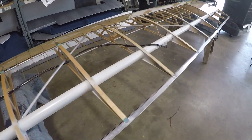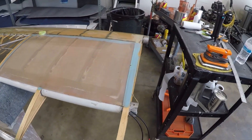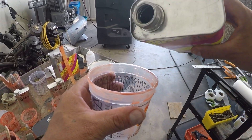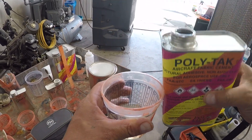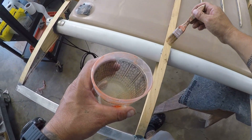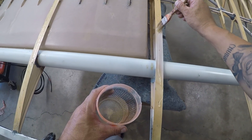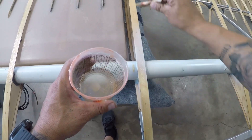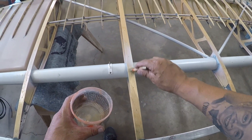Now on a Kit Fox wing, the bottom of the wing is actually under-cambered. So before we start covering, we want to take some poly tack straight out of the can and pre-coat the bottom of the ribs. The reason for that is because of the under-camber — you basically want to glue the fabric onto those ribs before you start shrinking so that it doesn't bridge. It will actually follow that contour or curve of the bottom of the rib. That will be covered in part two of the video.